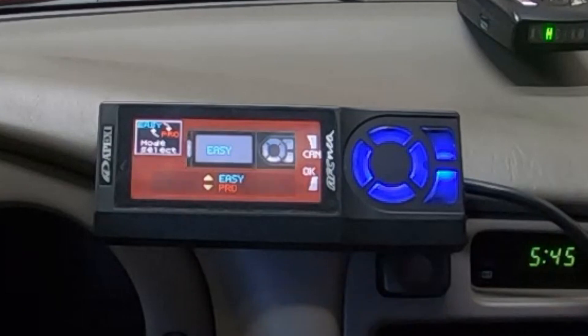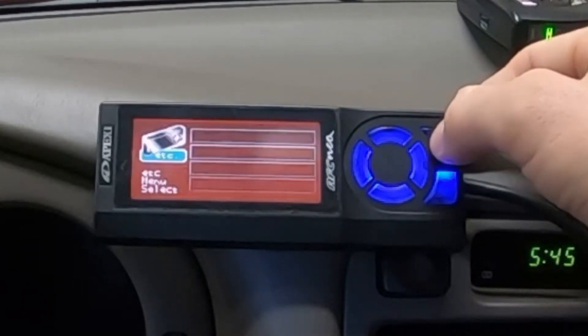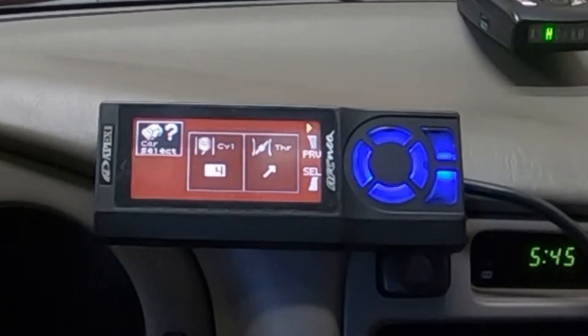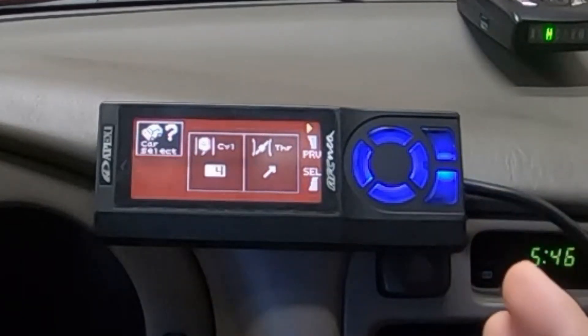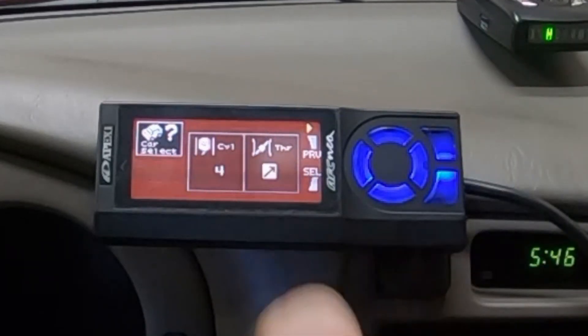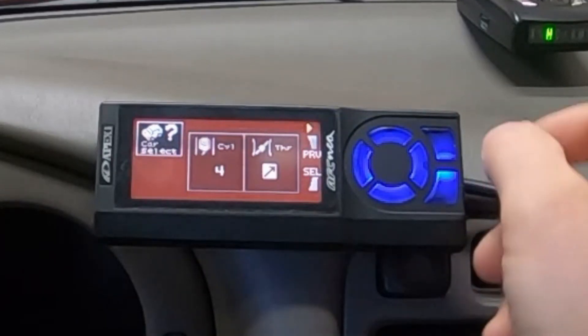Go to Car Select and hit enter — this is where it gets a little tricky. At first I had it set to eight cylinder, which makes sense because I have a V8, but the RPM readings on the display were half of what they should have been. Reading online I discovered that the NEO treats a V8 kind of like one bank and another bank, so if you put it on four cylinder it will behave properly. Set it to four cylinder. Then in the throttle setting you'll need to turn the ignition key to the on position.